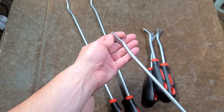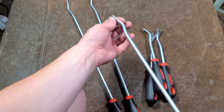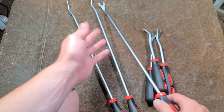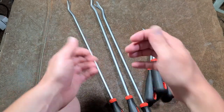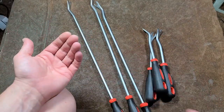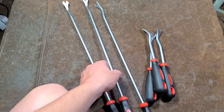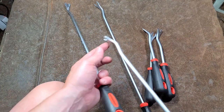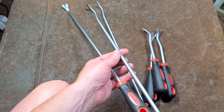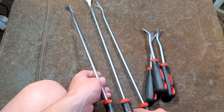The really nice thing about these tools is that you're actually reaching under the rivet and popping it linearly to the place where it's mounted. Many times you get up to the edge of a body panel and you're just pulling at an angle, and that's why many rivets break. But as you pry off the panel, you can get these tools in there and pop the rivets nice and easy.